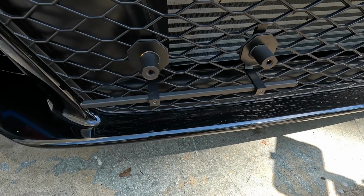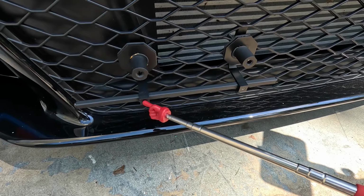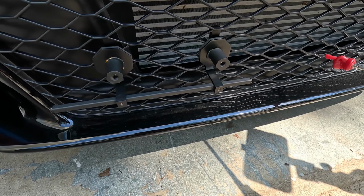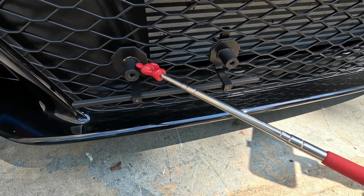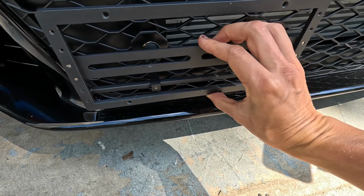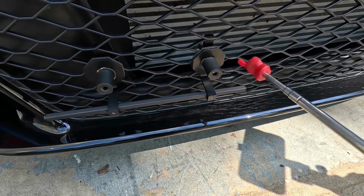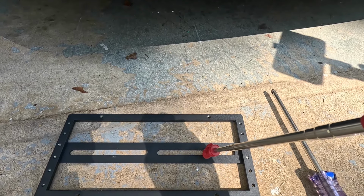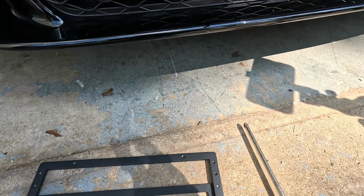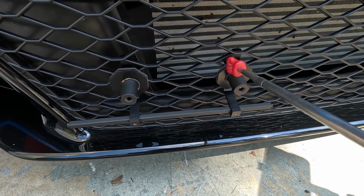Now here's one option that you could do, but you're going to have to remove this stud and this stud in order to do so. So take the Allen head screw, loosen that one up, and basically take that bar and remove it from the system. But you need to remove this stud as well, because what you would do is mount this license frame right here, and it'll go closer to the grill itself. And then just take some screws and drive it through the license plate frame. You're going to need two screws, one on this side and one on this side, and drive it through here, and make sure it protrudes right into the backside of that Sly license plate mount bracket right there.